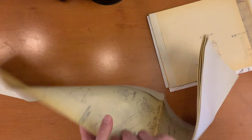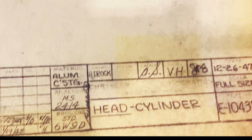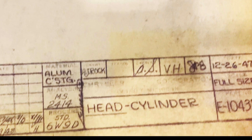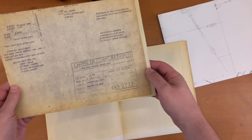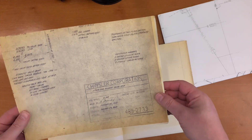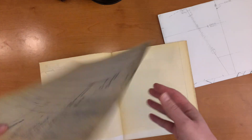And that's why we never saw a V6 Hemi. A V8 Hemi made a lot of sense in a way, although you'll notice that eventually they changed that Hemi into a polyspherical head, thinking they'd get most of the benefits with a little bit less cost and a little less size. And then later on they went to the wedge because they realized, quoting Pete Hagenbuch, that silly polysphere didn't really do anything at all for them.